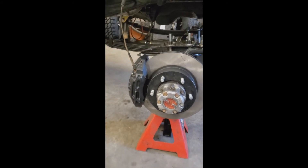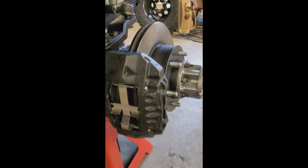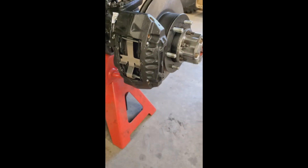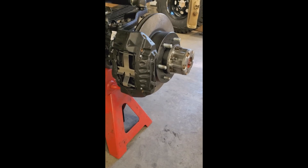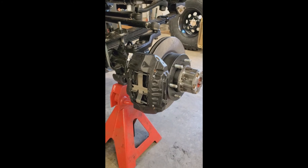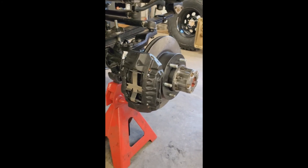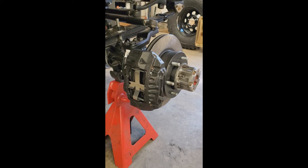Just forgot to mention — you may run into clearance issues, so do be careful. I believe Clinton had the same problem on Dirt Garage. The caliper is obviously a little bit larger. Aluminum wheels versus steel wheels — it kind of seems to be a consistent issue. Sometimes you will have to run a slip-on spacer like a quarter inch, but I usually just grind down the first fin of the caliper. I've done that in the past, and we'll see how these fit.